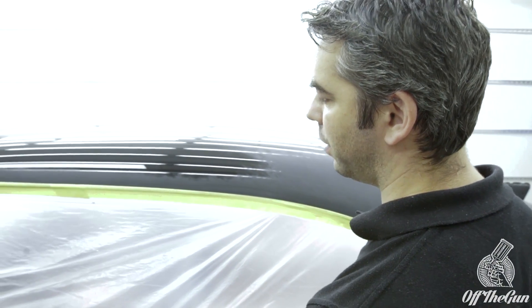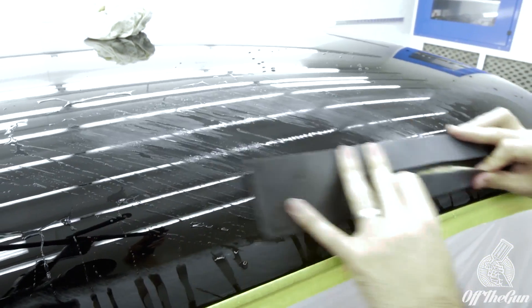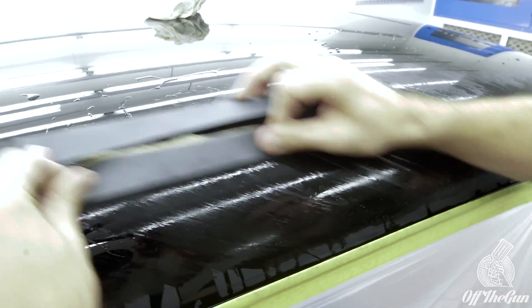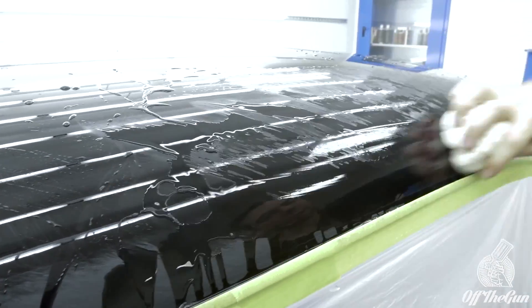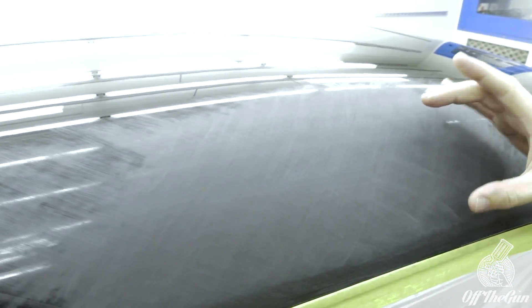Here we are back on the '57 again. We've got the roof — it's been painted. This one's going to get flow coated, so it's in clear at the moment. We just want to soften out some of that peel, level it out, chop it down pretty nice, ready for some clear. So we're going to use a spline for a bit of a wet rub — it's got some 800 grit folded over it, just doing this one by hand. Just chuck a bit of water on and get started. You just rub it like normal, 45-45, but the spline will automatically slice that peel out very accurately. We've finished rubbing this small section on the roof — you can see the area that hasn't been touched still has a little peel, but as we transition to the area we've rubbed, you can see how easily the spline picked up the peel. It's only 800 grit, ready for clear, and the rubbed section is completely levelled out nice.